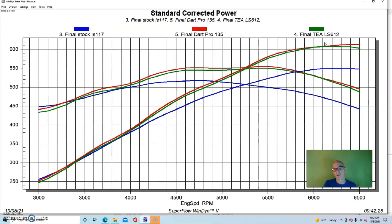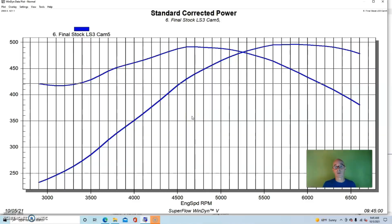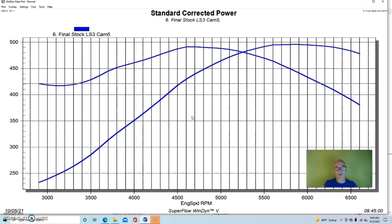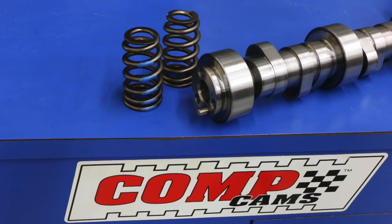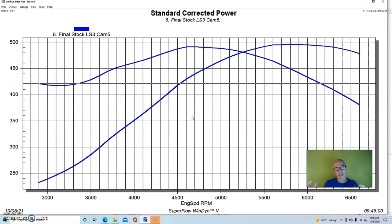Before we go to the whiteboard, let's take a look at camshafts. I almost always recommend camshafts for any sort of upgrade — if you're going to upgrade a five-liter Mustang, a modular motor, or a Coyote and put a turbo on it, cams and springs are usually what I recommend. You can run the factory camshaft with boost and it works, but it will be very mild. The boost just multiplies what's there, so a camshaft is always one of the upgrades I recommend for a turbo application because the gains are then multiplied under boost.